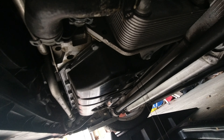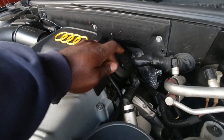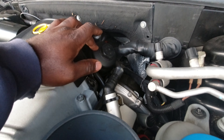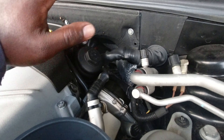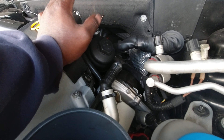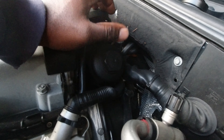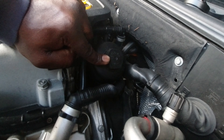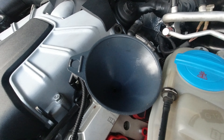The drain is almost fully drained. I'll go ahead and clean the drain plug, place the washer, and tighten it up after replacing the oil filter and seals. You can hand-tighten it or torque it to the exact Newton meter spec shown on top of the cover. After that, we go ahead and put oil in the engine.